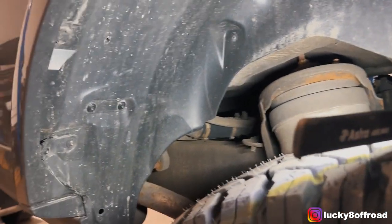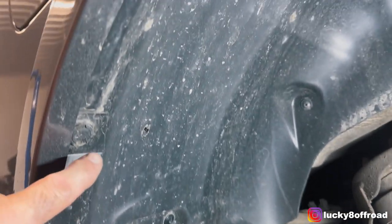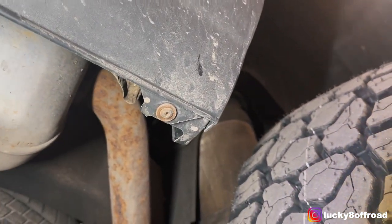Inside the fender well, I'm going to want to pull that Phillips screw out of the way. I'm going to want to get rid of that pop rivet, that pop rivet, and wow, all the way over on the other side. There's another one — almost to the top. There's also a Phillips screw, and we're going to want to pull those off down here, and then we'll be able to pull that fender flare off.